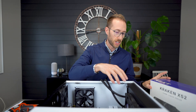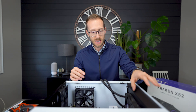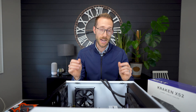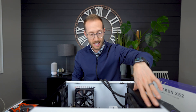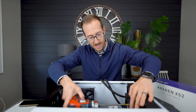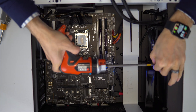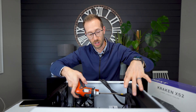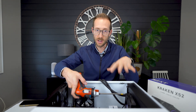Next is getting the fans out with the all-in-one. This case I do not like — it's the NZXT H510i. But it has a nice little compartment where you can put the radiator and then bolt the fans. I'll disconnect each of the fans. The radiator is actually floating; it's only held on by the fans, so as I take the fans off the radiator kind of drops in.